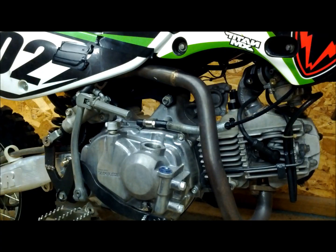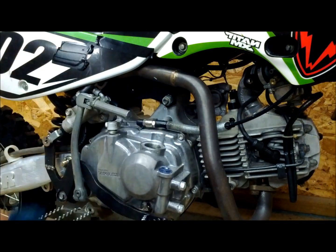There's always some debate on what engine oil is right for these engines. Some people say a 50-50 blend, some say full synthetic, some say non-synthetic. It's your bike, it's your choice. If you have a modified bike like this one, you should be running some type of synthetic, whether 50-50 or full. If you have a stock bike, you can run non-synthetic oil. I've always had good luck with Castrol Superbike — it's a full synthetic, 10-40. Whatever oil you choose, try to stick with the same name brand and same type, synthetic or non, throughout the life of the engine.